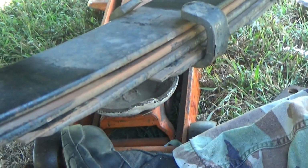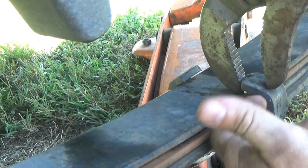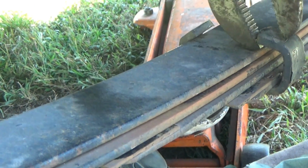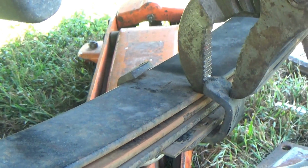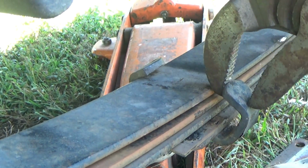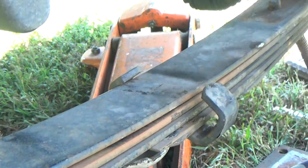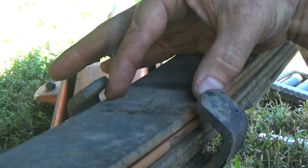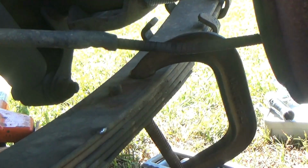Then once you get it out like that, make sure you got a couple of teeth engagement here. And if you got a really good, nice bite like these do, you get a worn out set, I promise you, you're fixing to knock yourself stupid, because these things aren't the easiest to bend. That should pretty well do it. Now if I knock the leaves back in line, you see that we got a good spread here that those leaves will be able to come out through the clamps. So next we're taking that bolt out.